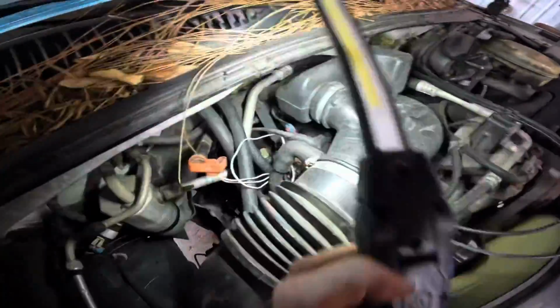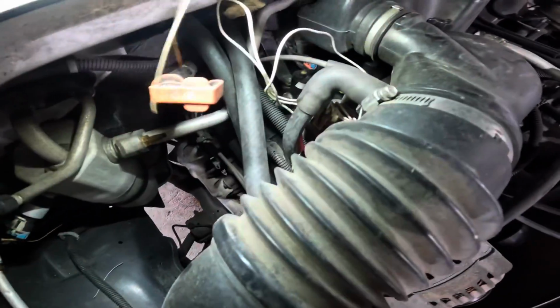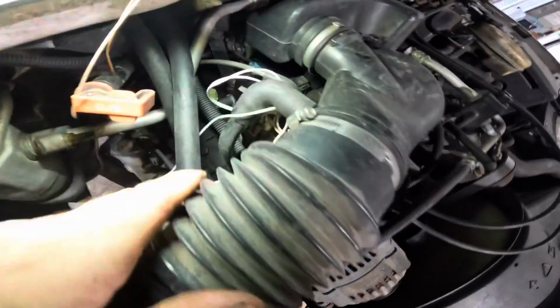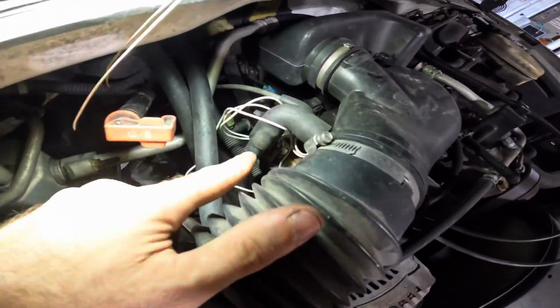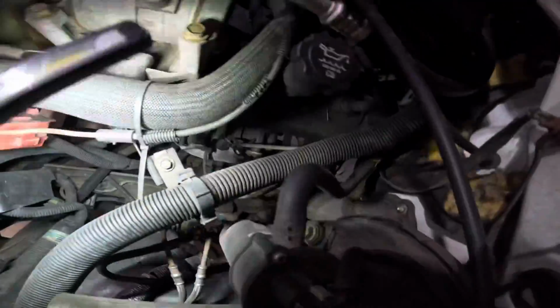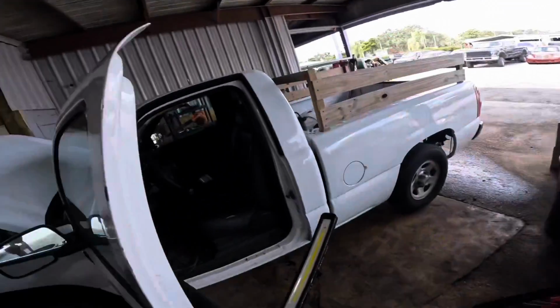What is this? Got some dangly wires here. Hang on, okay. Couple wires. Oh, that's a replacement pigtail for the ignition coil. Okay, so it has had some kind of work done to it. I don't think that's the issue though. All right, let's go grab that scan tool and see what's going on in the ECU. I hear a rattle noise down there too. Ah, found it. It's a heat shield on the exhaust. Okay, that's of no matter. Got bigger fish to fry.